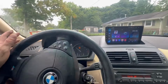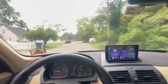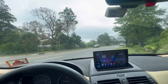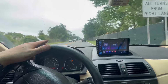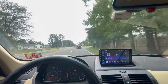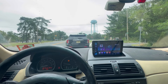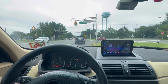and another two lights, it's a BMW, but they're on because the front drive shaft is out of the car right now. The U-joints went bad, and I had to order one but there's two different styles. There's one for 2005s made before December, and 2005s made after December. So they're two different lengths, and I bought the wrong one, even though it was for an '05. It ended up being, I believe, 702 millimeters long, and I needed the one that was 718 millimeters long. So I already got the new one on the way, but I could already tell you guys that 100% that wheel bearing was our issue.